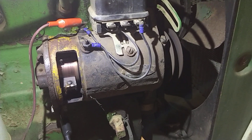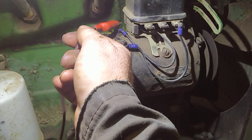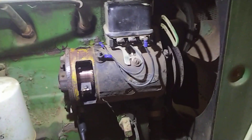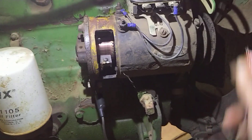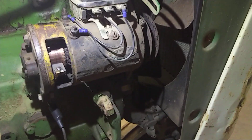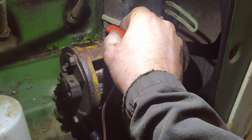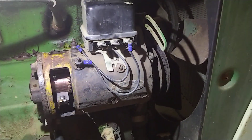And motoring like that tells me that the rest of the generator itself is also in good condition. And when your generator is hooked up and you want to polarize it, with the belt on and ready to run and all hooked up, you take your battery positive. And all you have to do is touch battery to armature, and you'll get a spark, and now it's properly polarized.